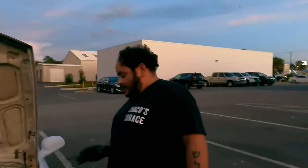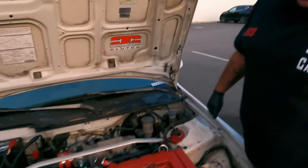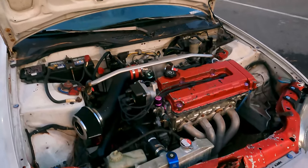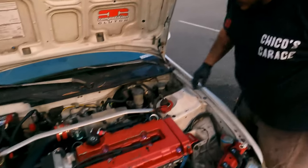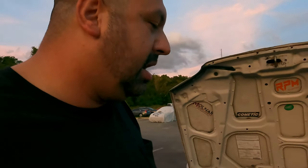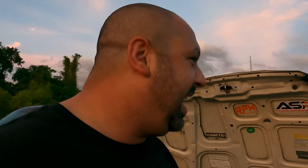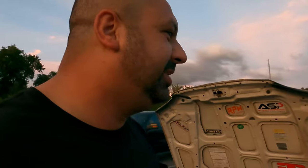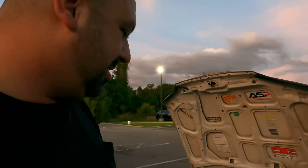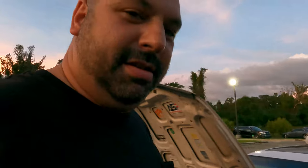Make sure my cam gears are set at zero because it goes to the tuner on Monday. I got a fuel line leak out the fuel pressure regulator. I also have a coolant leak somewhere that we're gonna hunt down and fix. Other than that, that's all she has and needs. I think we can get it right. Just a little bit here, a little bit there. It'll be fine. We'll put it down a quarter. It's only gotta run, what is it, 1320 feet? Something like that? From green light to finish? Yeah, gotta balance the tires, check my alignment. I got a nasty torque steer on it now. We'll make it right. That's what we're here for. Yes, sir. That's what we're here to do.